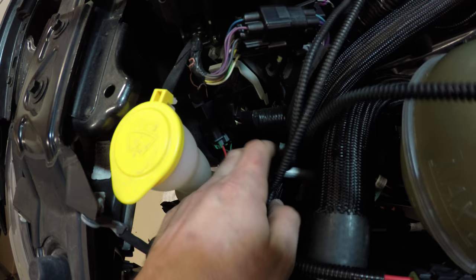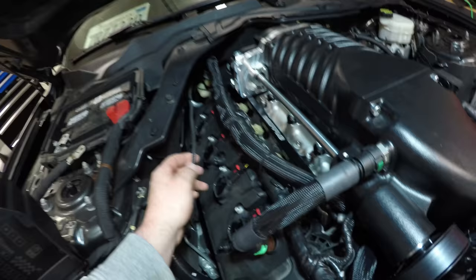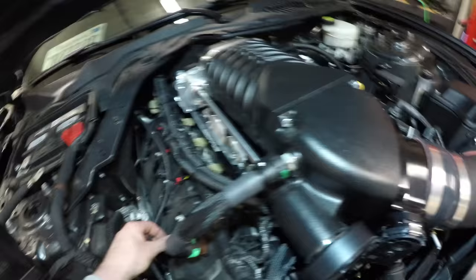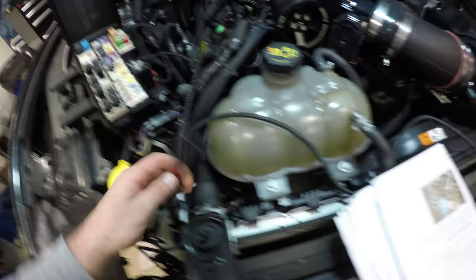We have two green wires that are in one jacket, if you can see those, but that's this cable that runs back here to the passenger side IMRC connector, and that's something that we've already connected earlier, actually before even installing the supercharger blower. So that's already plugged in back there. Then you have a fuse that's going to get mounted up in here somewhere, and then the power.